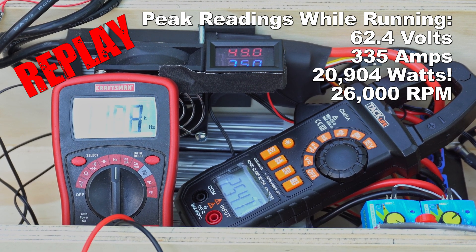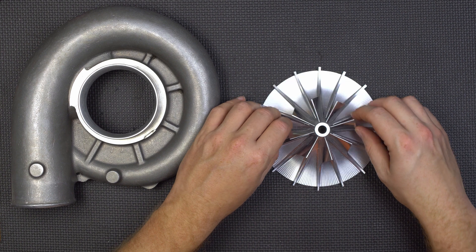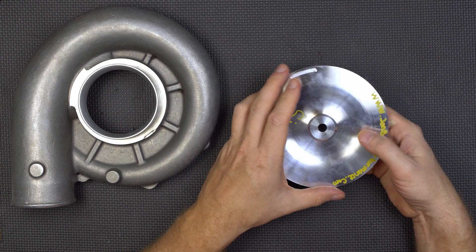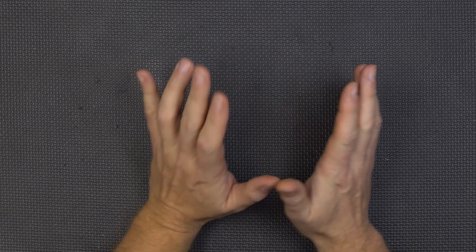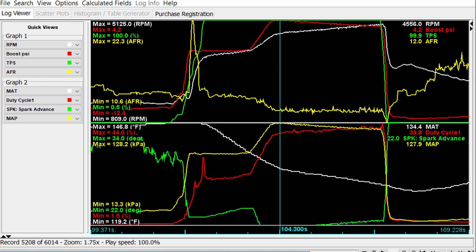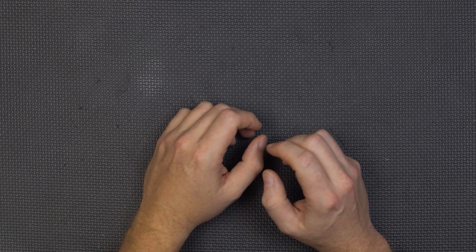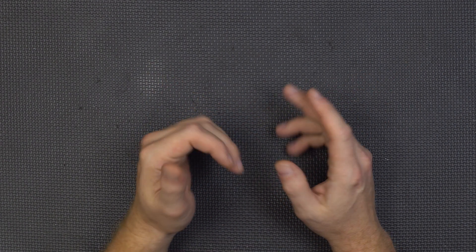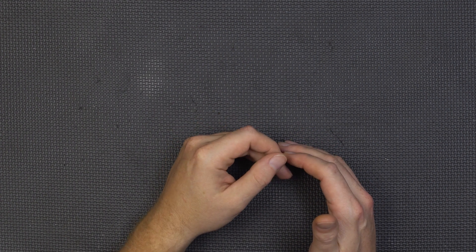The only reason there was actually a gain was because the impeller from John Bond Performance — not sponsored, I paid for that thing because it ticked all the right boxes. And that showed, because we did pick up about 20 horsepower. We did see peak boost of 4.2 psi during a pull, which we hadn't seen before. We also saw a higher duty cycle, and if you take into account the brake specific fuel consumption, you can actually calculate approximately how much horsepower you gained — approximately 20 horsepower. But remember, we're still putting the same amount of work into the system as the system is delivering in terms of compressed air and flow.